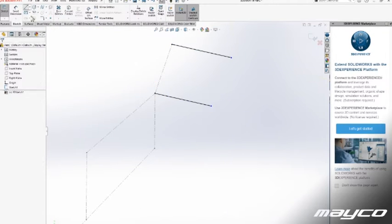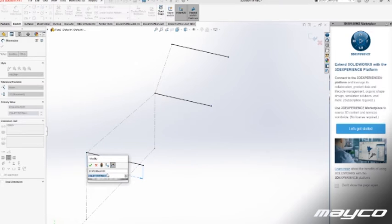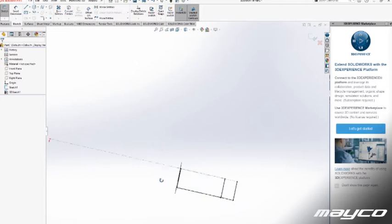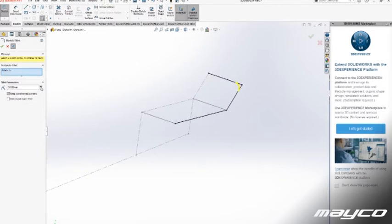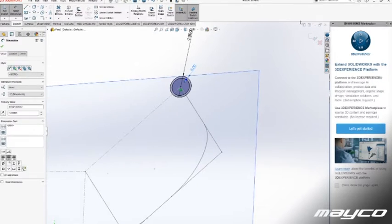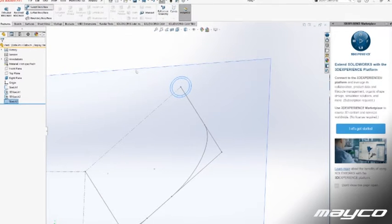So you've seen me design the rear suspension mount on the inside of the chassis, nice and close to the battery pack and underneath the crash rails that are there. And I'm trying to design a simple frame that I can use to connect all the parts that I have. So for example, the axle needs support with some bearings, and I need to hold the caliper down for the rear brake system. I need to mount a motor somewhere, and all that needs to be held together with the subframe.